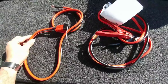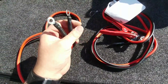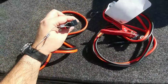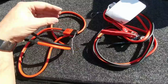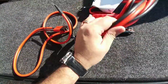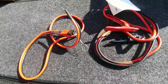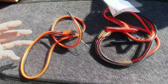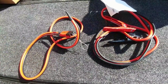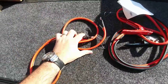This is going to be a really simple installation. Basically all I'm going to do is wire the red into the battery connect terminal and wire the black to chassis ground, and it's going to give me a quick connect plug to attach closer and more conveniently to the outside of the fifth wheel — so I can connect jumper cables if I need to power the coach for whatever reason. Let's say the truck's not here and I have a backup battery, or the coach battery is dead and it won't let me operate my landing gear.